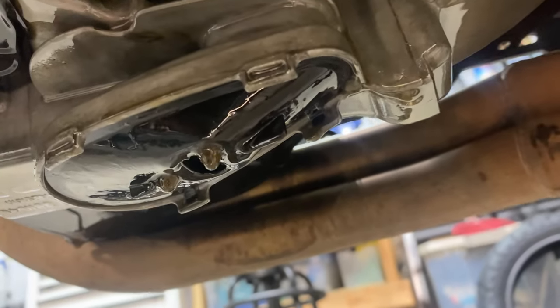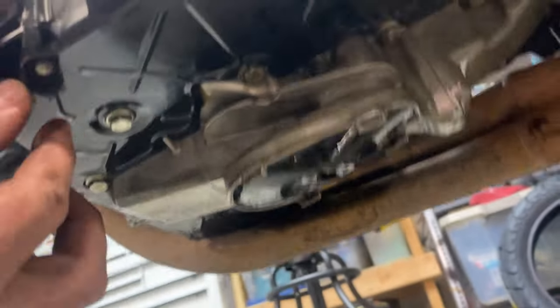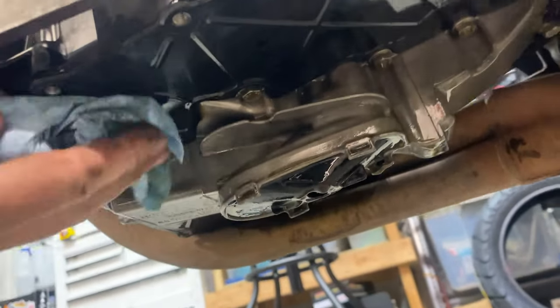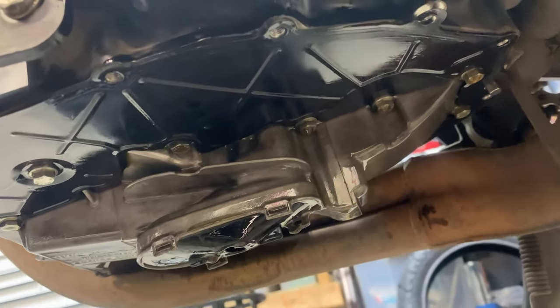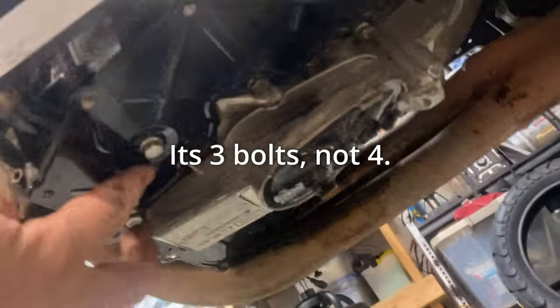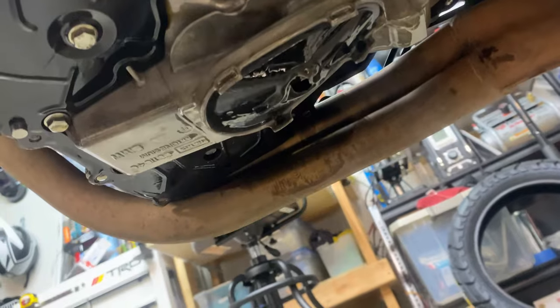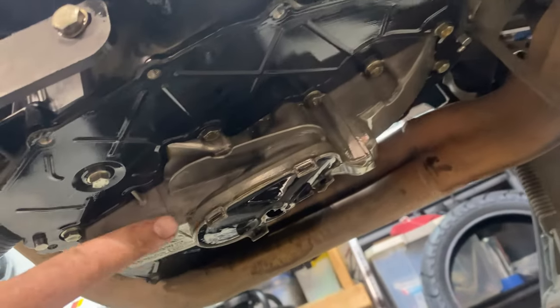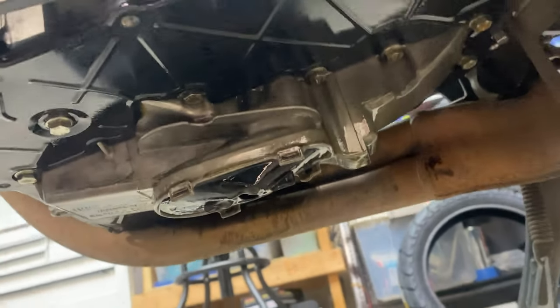More pieces of clutch came out of my oil strainer, so we're gonna pull that off and see what's behind there. I did buy another strainer as well as this gasket here. We'll also pull that gasket off, which I believe is another four bolts - potentially one here, two back there. I'm hoping to avoid pulling this off, but I did buy the gasket for that as well if needed.